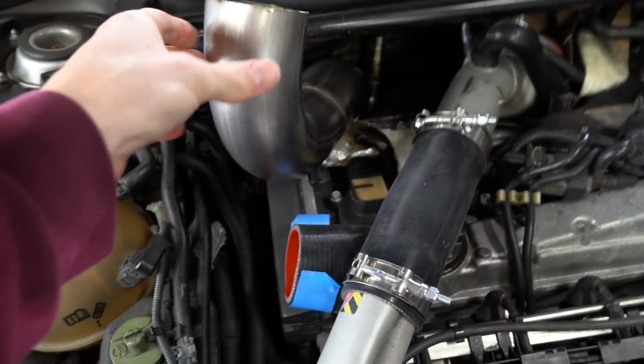I just went ahead and I tightened up all the exhaust studs, and actually, this is what happens when you don't have a dog bone mount that's actually tight. This motor just rocks back and forth. It may be good side to side, but this whole back and forth motion is completely rendered useless. And luckily, the way I designed this hood exit, it won't interfere with any part of the chassis, so that is good. So we'll be good for our drive, but that is something I definitely have to address.